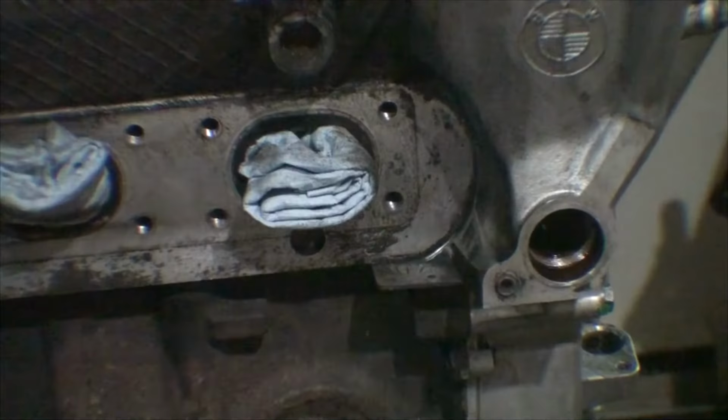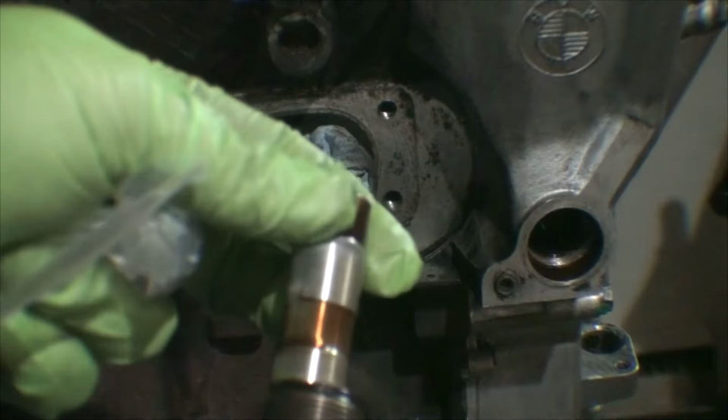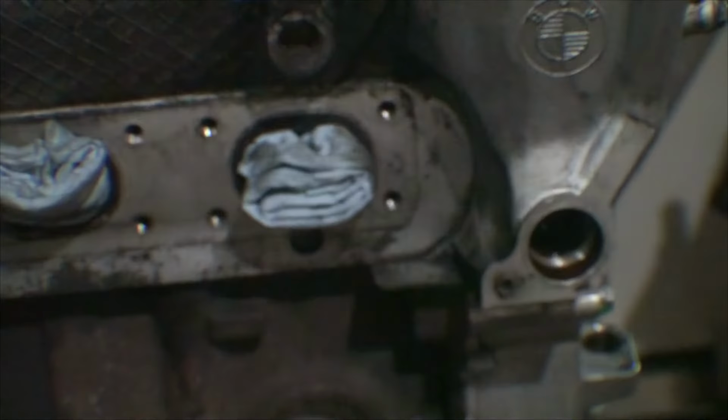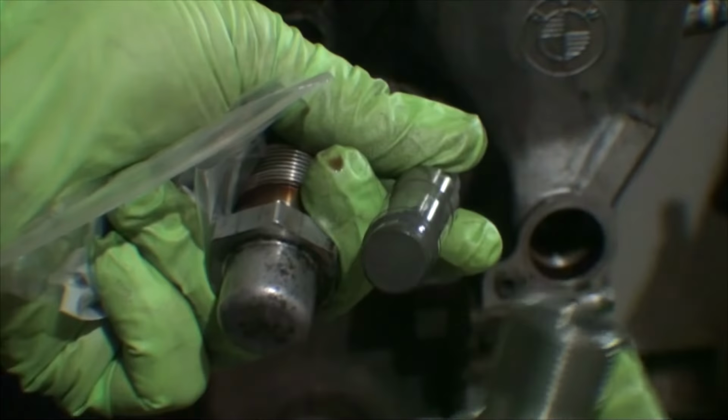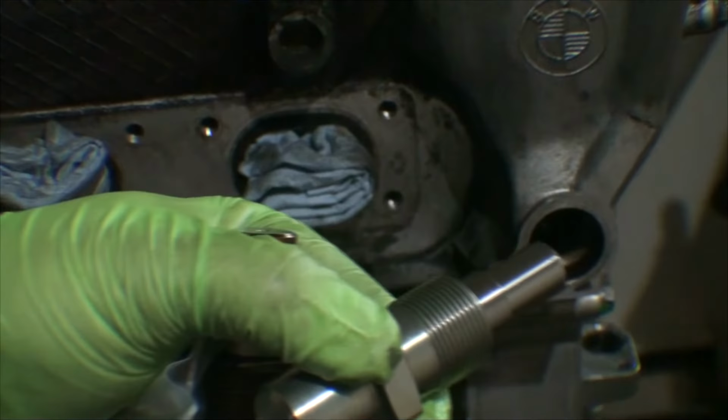The hydraulic one is the upgrade in this case. So here's the difference. This is the old tensioner. And you can see it has a spring on the inside, so there's two pieces there. That spring wears out, and over time, you lose tension on the guide rail here. This is just a hydraulic cylinder. No spring inside there or anything. It's all hydraulic pressure. So this can maintain tension much better at higher RPMs. That's the upgrade.